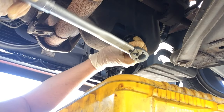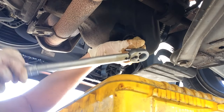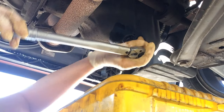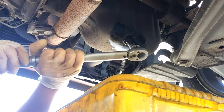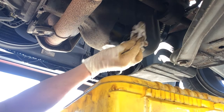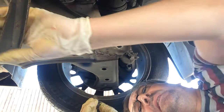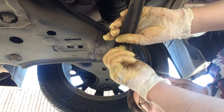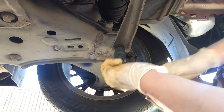Don't forget: if it's the 1.2 or 1.4 litre 8-valve, this sump plug is 45 newton metres. If it's the 1.4 litre 16-valve it's a different spec. I find it really strange that in my vast collection of tooling I don't have a 16mm socket aside from one that's in my impact set — annoying.